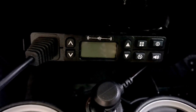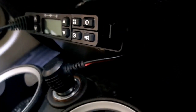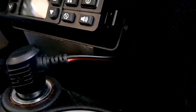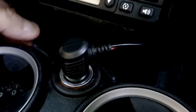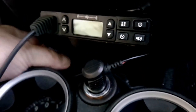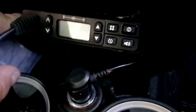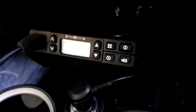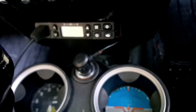Hope this helps you program your radio. My installation is in a 2011 Mini Cooper. I have built a platform underneath inside the console - the platform is a simple wedge block of wood with the mounting. These mounts are really nice because they allow you to pull a couple of clips and pop the thing out. There's actually a rubber shelf in here that's very easy to remove. Basically pushing this clip aside and pulling the thing out makes it very easy to remove. This shelf will pop up and pull out - I have it at about a 40 degree angle sitting in here. I hope this helps you with your installation and understanding of the unit.